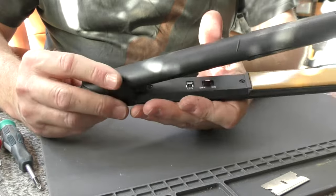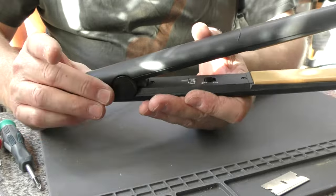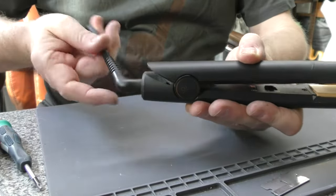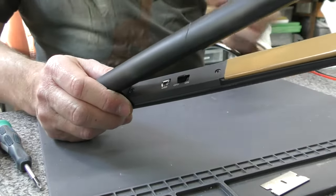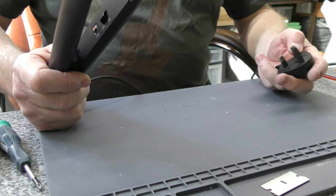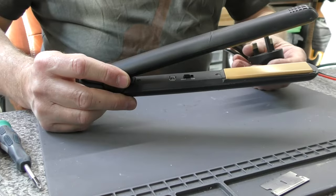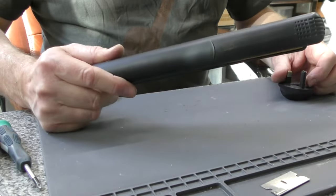Do check that there are reasons why those resistors fail — they can fail on their own, but other times it can be caused by sparking in the switch, sparking in the mains cable socket area, a faulty mains cable, dodgy plug, dodgy socket, or perhaps somebody using an extension lead, or they've been used overseas where the adapter is a bit wobbly. Any sort of sparking can cause those resistors to fail. So do check for a cause. So there we go — GHD 4.2s.